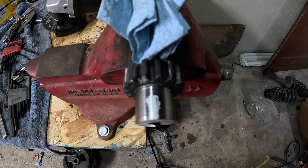I went up and measured the keyway on the engine — it is 1/4-inch wide and 1/8-inch deep. Kind of strange, but that's what it is. I have that roughly marked out here, and I've got my friend the Dremel. We'll see what we can do here.